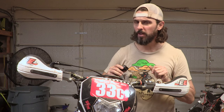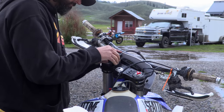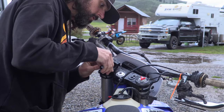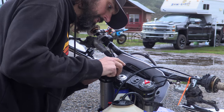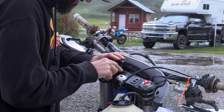I was deep in the woods of Colorado about to install the Mako 360 while making the small parts video. I pull everything out, get the handlebar off, remove the clamps, and attempt to install the perch. Unfortunately, it does not fit. The pillow on top of the triple clamp is too big — the perch cannot sit on it.